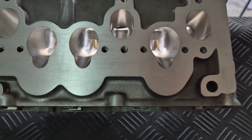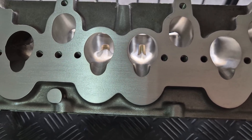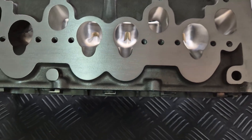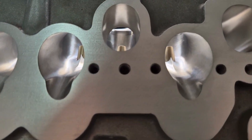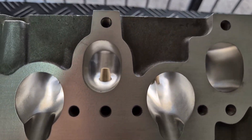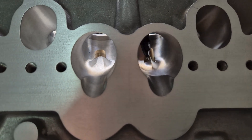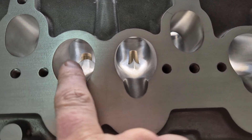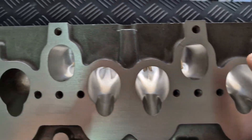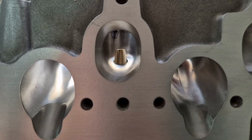Attention to detail is about horsepower, not a pretty shiny port. There's attention to the short turn radius, the valve seats, and the combustion chamber — how big the piston is, how much we can shroud open. If we're sitting with a piston that's 84.5, we can open a little bit more and get the shrouding done right. It's about what cam size you're running, what the setup is for — is it a track car for exit speed or a drag car foot flat? What do you want to achieve on the dyno graph? Does mid-range matter? You can see the port difference between the basic port and the attention to detail port, especially around the valve guide area on the exhaust port where there's quite a bit more flow.